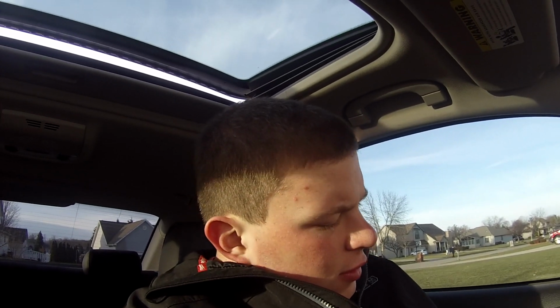Alright, so the cold air intake's on. The coolant temperature is within a few degrees of last time. The car sat for the same amount of time as last time. So I'm going through the scanner and pulling up inlet air temperatures, which are about the same as last time to start. I'll put the scanner in the door, we'll go for the same drive, and we'll see if we get the same results. So I'll report back at the end.